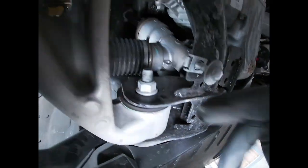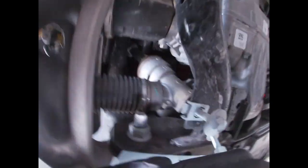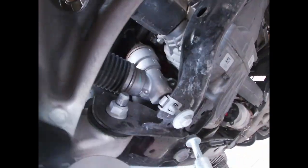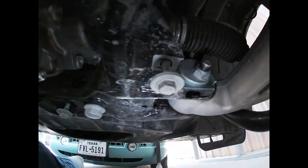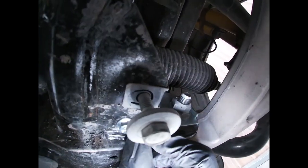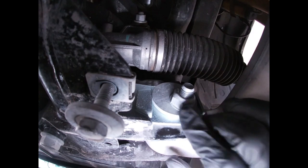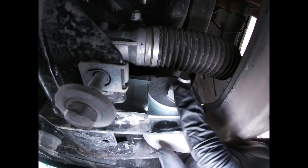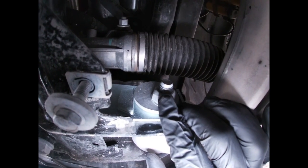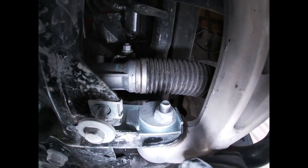The camber goes right here — this part goes right here. Let me show you guys how the other one looks installed. So that's how the other one looks. You have to tighten this bolt back here, which is a 10 millimeter. And then you rotate this washer as much as it goes in, then start tightening this bolt. You never pull this bolt out. Like I said in the previous video, I want to keep my camber alignment as close to stock as I had it before, so my alignment's not all crazy out of whack and I have unwanted wear on my tires.